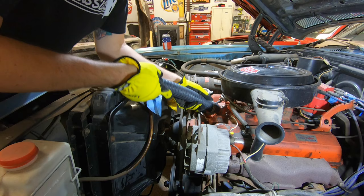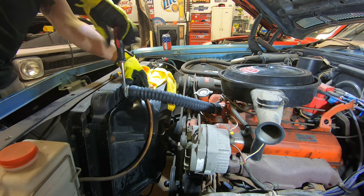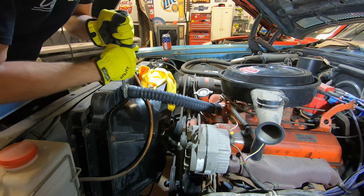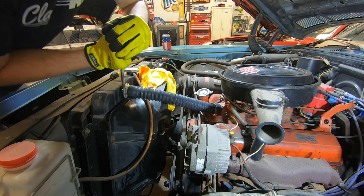I'm lazy. I just want to switch the hose out, and then I'll top it off with whatever antifreeze I lost. That's what I want to do, because old antifreeze is a pain in the butt to store and to get rid of. I know this, believe me. And on these, when you're cranking them down, once you think you have it tight enough not to leak, crank it like three more turns. All right, now we got fresh oil filter, and a new rad hose, and I topped it off with new antifreeze, so let's go for a cruise, see how she does.